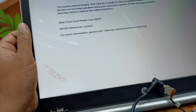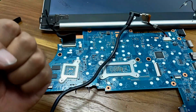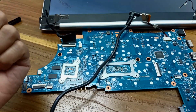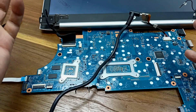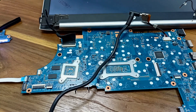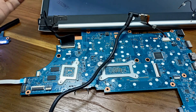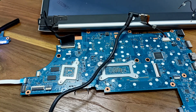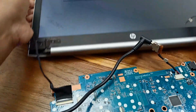Thanks for watching. The problem came from the charger. I had no idea before, so that's why I went through all the other steps — that was my learning experience. I found that the 3.3 volt, 5 volt, and other voltages on the motherboard were all okay, but the motherboard was not turning on. That is why I suspected the charger, and when I checked it, I found the charger was the problem. Thanks for watching — if you like this video, don't forget to subscribe to our channel.